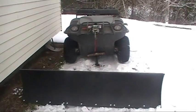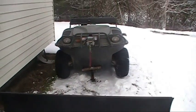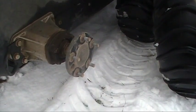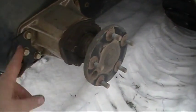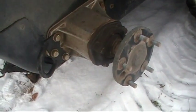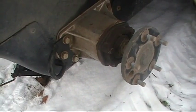I've got the plow outside. I've jacked the wheels on the front of the Argo clear. What I've got to do is take this plow — on the front of the Argo there are tow hooks right here — and I have to take off these front tires and remove these bolts inside here. I've got the wheel off. It's a Canadian-made machine so it's metric — it took a 19mm for the wheel nuts. This particular bolt is actually a 17mm, but I can't find one — a 5/8 inch is fitting perfect, so I'm going to use a 5/8 on this.